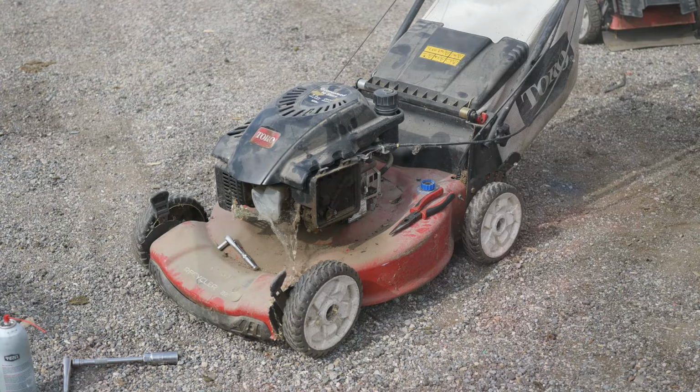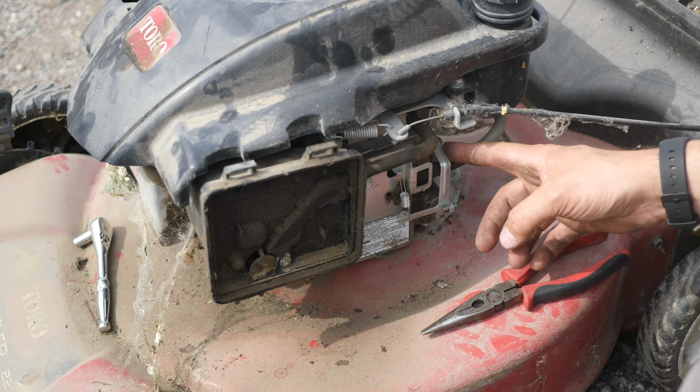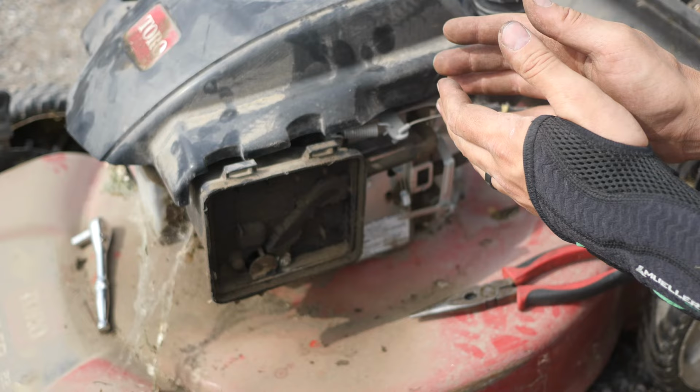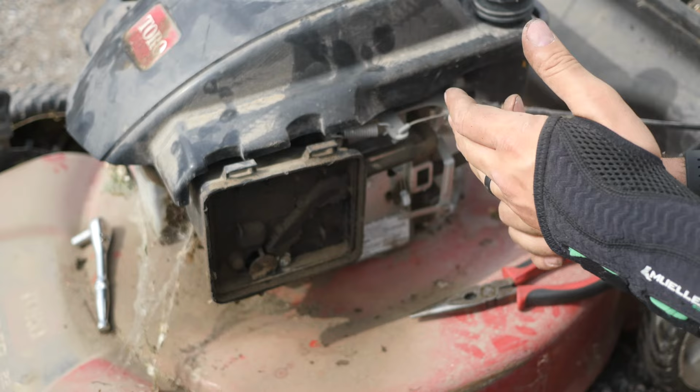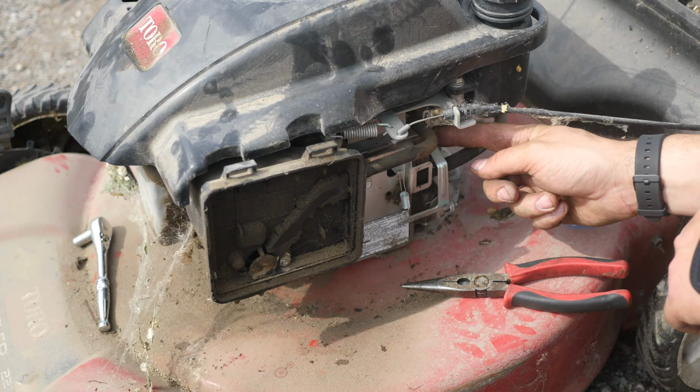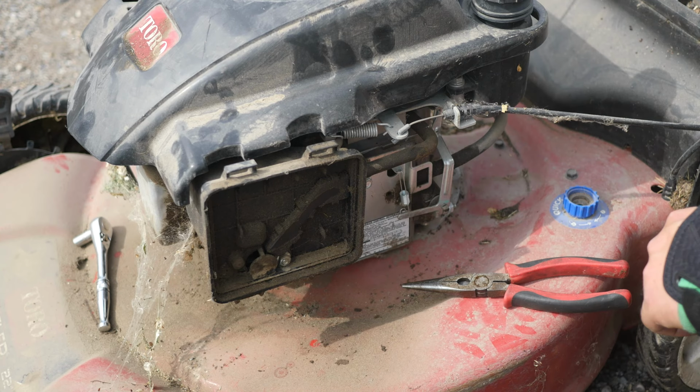All right. Here's your governor, and your governor goes inside, and there's actually a governor wheel that spins, and at certain RPMs it opens and closes these weights, and the weights make a rod go up and down. That rod directly pushes on a lever that comes through the side of the engine and is connected to this and runs your governor. The more this spring pulls on this, the higher the RPMs will go.